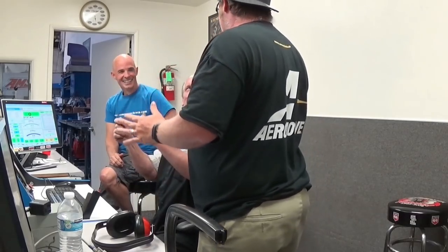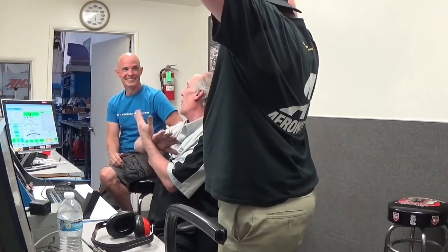And then it shook — I heard the shudder. As soon as it shook I watched it go. I figured the fan off, it kept blowing the header out. That was awesome. I am so excited right now because this was so much better than I expected. I thought this would be our least exciting one — I thought we'd just see something stop. It made more power with less oil — 308 horsepower. That's the way it goes. I think it was still at 39 pounds of oil pressure at some point. That's the residual oil protection we're talking about. That was epic.